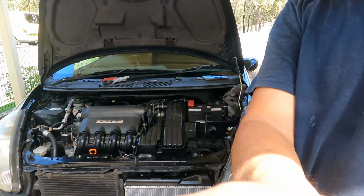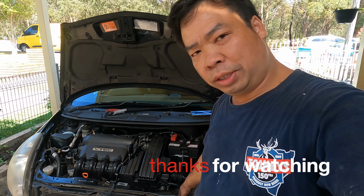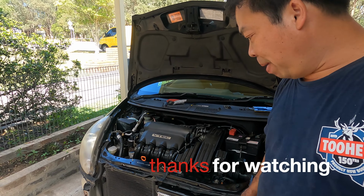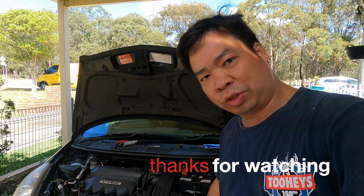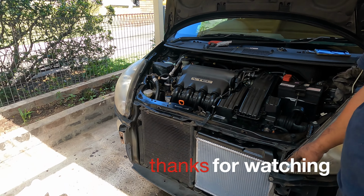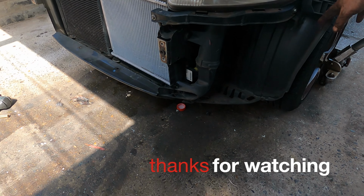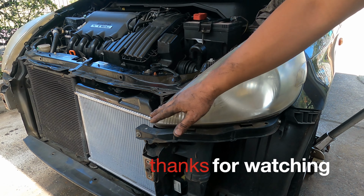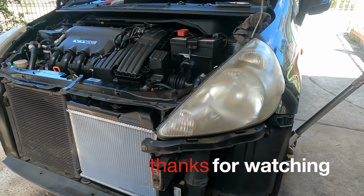Oh well. Later we let it run and suck in the water and fill up more water, and then we're going to put the cover back, the front bumper. So thank you for watching, and that's a little bit short video about how to replace the radiator for the Honda Jazz 2002. So when you take off the front bumper, you can do anything. So for this one, to replace it, you have to take off the front bumper, and even to replace this one, you have to take off the front bumper.